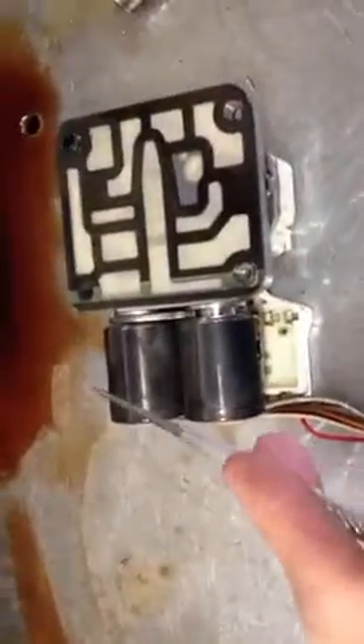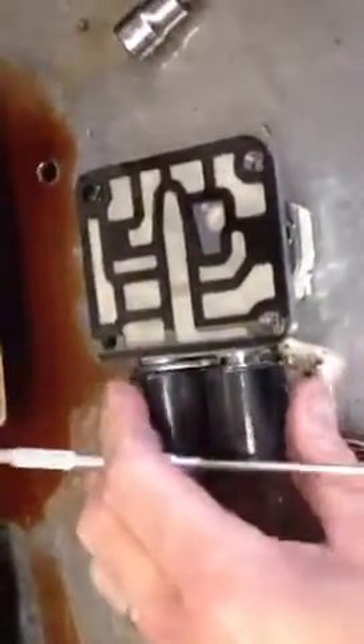A way to remedy that: obviously the drum needs to be replaced, but you also have to address the pressure rise concerns. This unit has an individual solenoid block assembly. It has several solenoids on it for pressure rise, shift solenoids, torque converter, and lock-up solenoid.